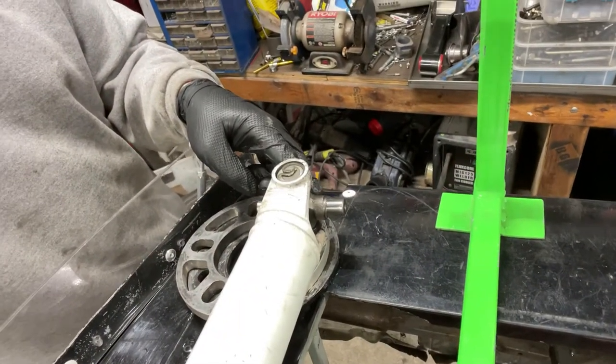That kind of stinks because I had to put a conversion U-joint on it. When I built this rear end I just had parts lying around. It's a Ford nine-inch rear, but apparently it had the long wide yoke on it. I didn't know anything about it — I know GM rears, I don't know Ford stuff. Apparently the wide yokes take the same basic U-joint as the GM ones I'm used to. So I had to get a 1310-to-1330 adapter to make this end wider, because I got an aftermarket drive shaft — a shorter one because it's a longer yoke pinion. I just built it. It works, but it's just a learning process. I've got to change that U-joint out.